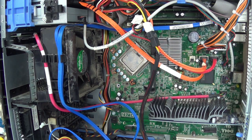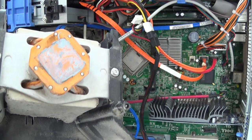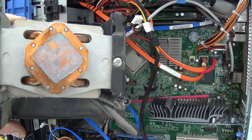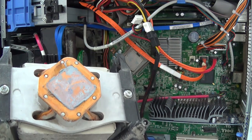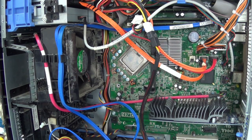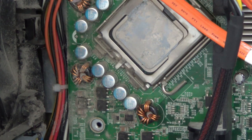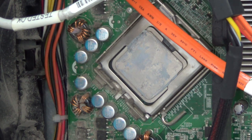So now I need to put the fan cowling and heat sink back onto the CPU. I'll vacuum that out because, as I showed earlier, it's just so clogged up with dust. You can see the heat sink and the copper conductors — heat conductors — and there's a grey paste on there. That's the heat sink paste; it makes sure there's proper transference of heat between the top of the CPU and the heat sink. Now, that goes hard when it gets hot, so I need to replace that. My son's got some, so I'll pop round to his house this evening and get some paste. I won't finish the job until I've put some fresh heat sink paste on to make sure the CPU keeps cool.